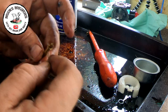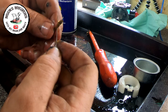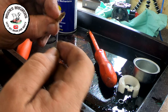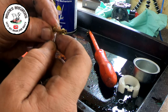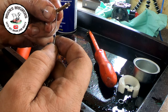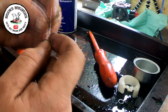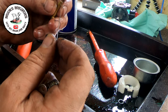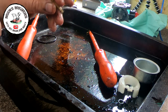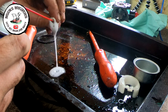Let's check the old tube - just going to run it in all the holes. That was blocked - it was, not any more. At the top as well. There's no telling how far this old gasket glue got in. There's one up here as well - don't forget that one. Let's give that a clean - cover and block some of the holes up so it comes out of one end. Move it up the other end, it comes out of the bottom. Just block different holes up at a time so it gets to run nicely.